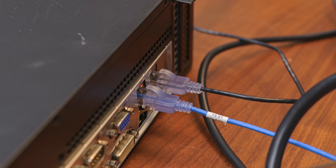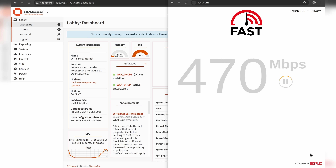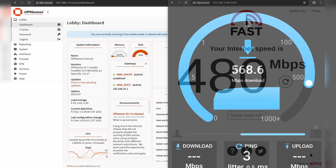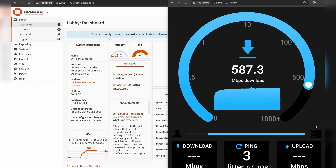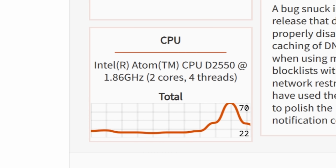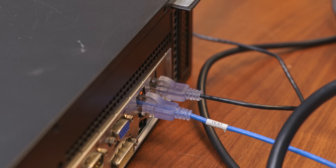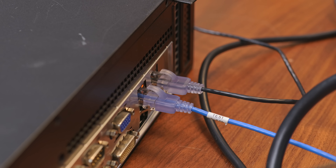However, you might not have the best time. The dual NICs in this are Realtek 8111Es, so if you're going to be using OPNsense or pfSense, you might run into some issues due to driver support. I did give OPNsense a shot and the interfaces were actually detected just fine with the default drivers, so that was good. However, the performance wasn't incredible. When connected from my laptop, I was typically getting around 500 megabits per second, either when testing online speed tests or a locally hosted open speed test server. The CPU usage wasn't crazy high though, so I would attribute this performance more to the Realtek NICs. If you don't plan on running a ton of firewall rules or VLANs and especially if you have less than a gigabit internet connection, this might work — but really this might make more sense as a test system to tinker with versus a production system.